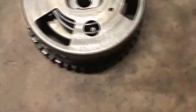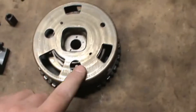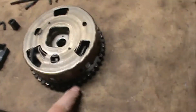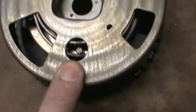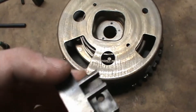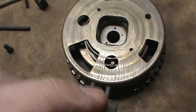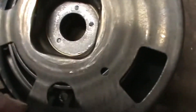So let's get started. The first thing you're going to do is take your phaser and set it up so that the cam gear sprocket side is down. Now you're going to find the hole that has the pin sticking up through it. Take the cam lock piece and insert it onto the phaser so that those two little tangs go over that pin, in between the spring. It takes a little bit of wiggling, but it'll go on.